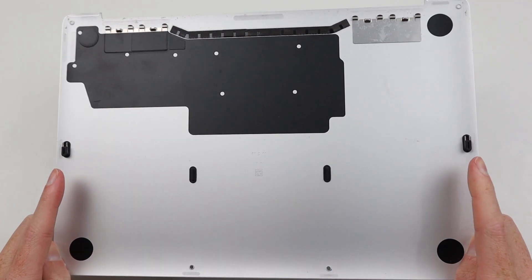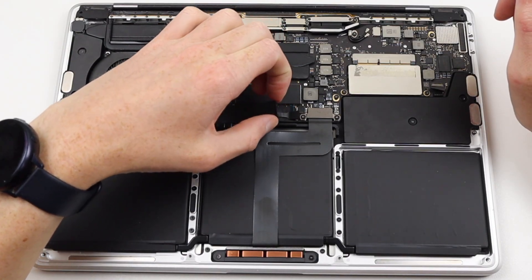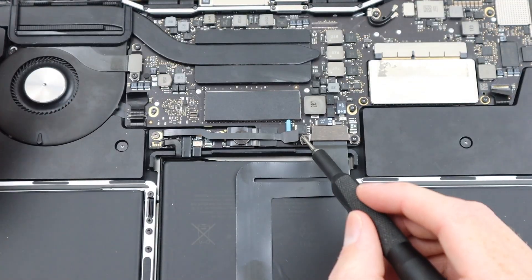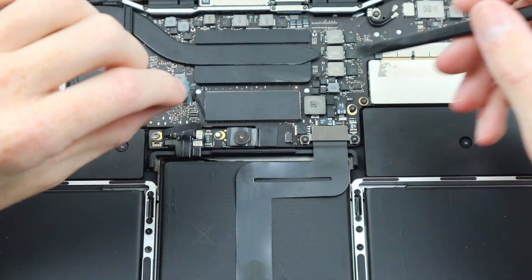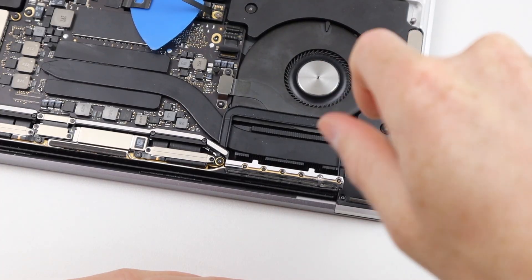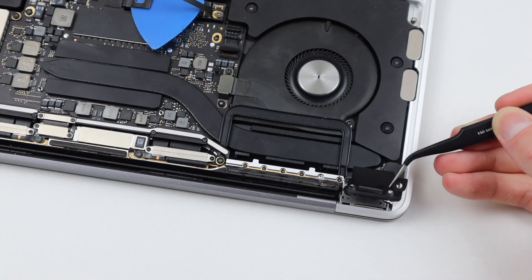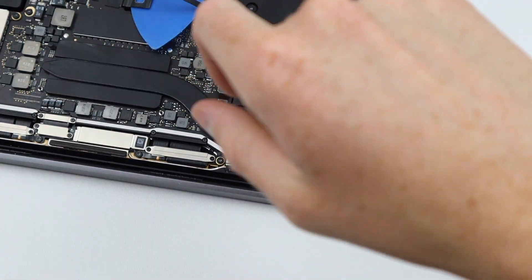You can see the clips on the left and right-hand sides. Inside, I'm going to disconnect the battery before I remove the display, as I don't want to damage my brand new logic board. You can see that they didn't apply some adhesive on that cable — that's not a big deal as I'll do that myself when reassembling the device. Removing the display is quite a time-consuming process given the seven different driver bits needed to perform the repair.